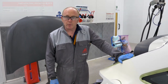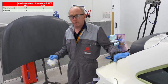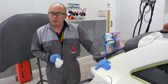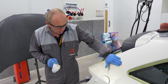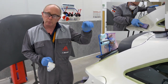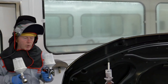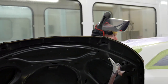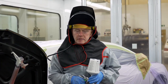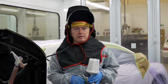The car has now been standing in the workshop for 23 minutes and in that time I've managed to prepare my bonnet for wet on wet — my colour is mixed and ready to go. Now just like any normal 2K surfacer or filler I'm going to sand this in readiness for the top coat. All products are mixed as described in the TDS. Please ensure the base coat is activated or hardened.